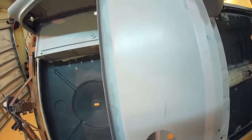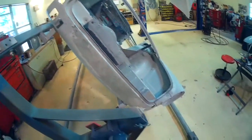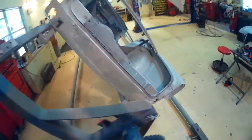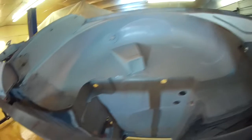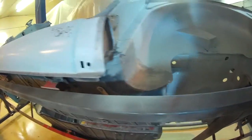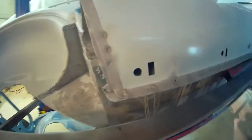So I'll leave it here in the shop and leave the air conditioning on overnight to keep the humidity out — I think it'll keep it from flash rusting so bad. Next step is to sand all the surrounding areas; I'm not going to sand the whole thing, just the areas around the bare metal and welds. Get some epoxy on it.